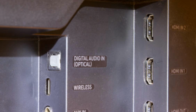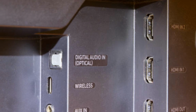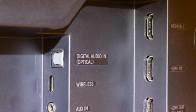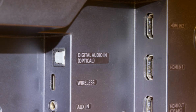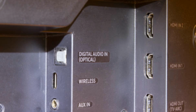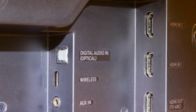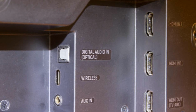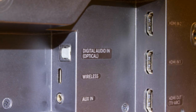You can use Bluetooth to stream music to the soundbar. It does not support the aptX codec, but you'll get a much broader range of music sources by connecting the speaker to your Wi-Fi network. The MS750 has a dual-band 802.11ac Wi-Fi adapter on board, and you use the Samsung Multiroom app. The app displays a series of sources across the top, starting with the smartphone the app is installed on, along with many of the most popular services.